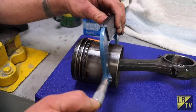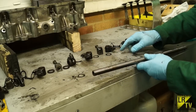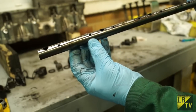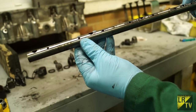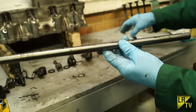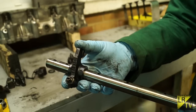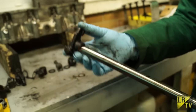We're going to continue with the cylinder head rocker shaft. You can strip it down and keep all the parts in order, but they should be cleaned first. The first thing to inspect is the rocker shaft — it has shiny parts where the rockers have been working on the shaft and dirty or rusty parts where it has been standing, indicating the unworn areas. As a rule of thumb, slip the rocker on and see how much play you have, trying it on both an unworn and a worn piece.